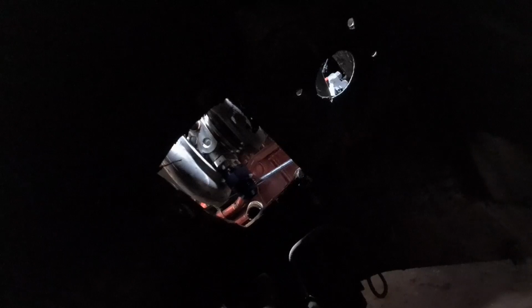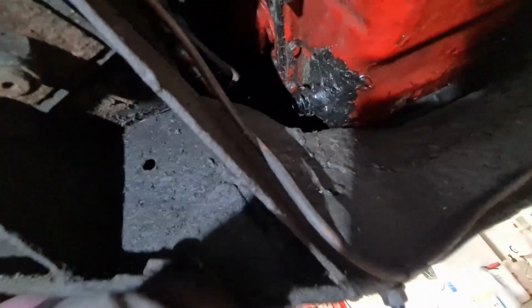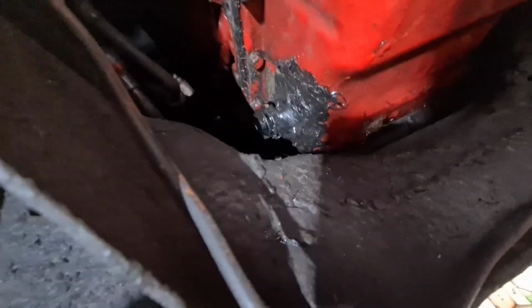I've cut out a piece of metal I actually welded in a while ago for the same reason, because of the turbo drain, and it was probably the reason why I made my manifold. So now I'm just basically undoing stuff I already did, and that was an old intake hole, I think. The old one's off, the new one's going to go from there to there, but via the inside, and I need to look at why I put sealant there, because if it's leaking I might as well deal with that, because I can actually get the sump off while the engine's in, unlike an MX5.